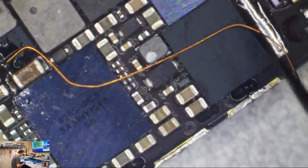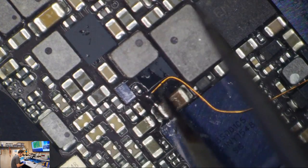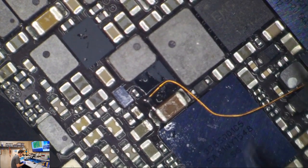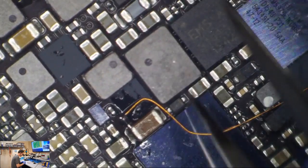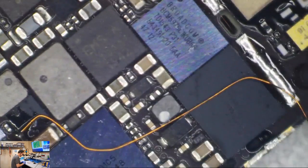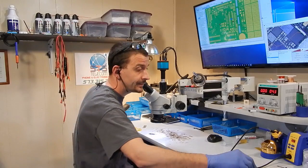Let's move our wire here just off of the visible exposed ground of this PCB. Our wire now runs right off of our newly installed filter slash fuse, makes a bend, comes around across what is probably the audio codec - yes, 338S, that's the audio codec - and cuts across the touch IC. I don't think we're going to have enough current flowing through this wire to create any sort of interference in the touch system, but that's something to keep in mind.